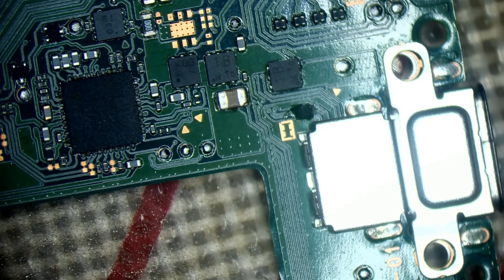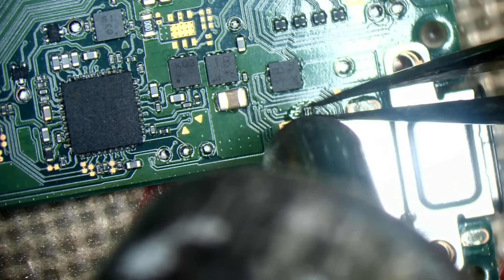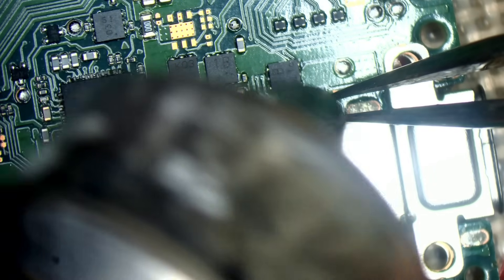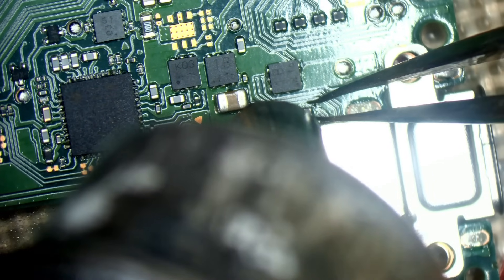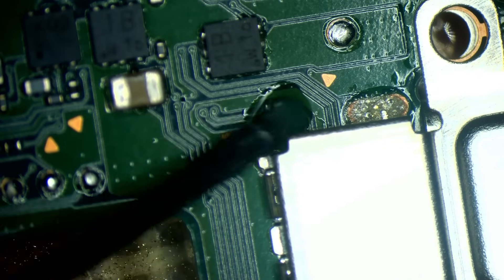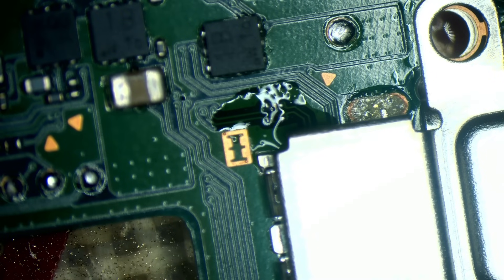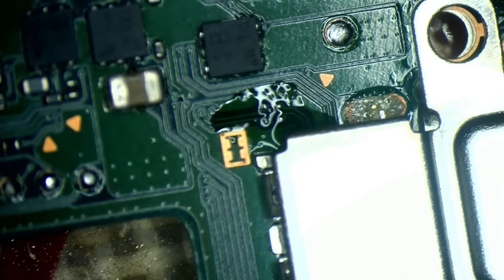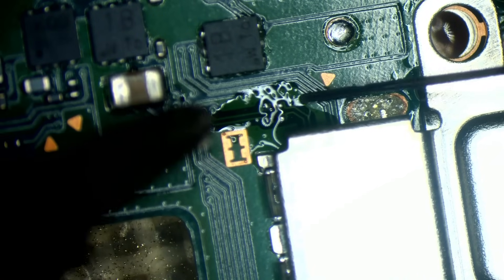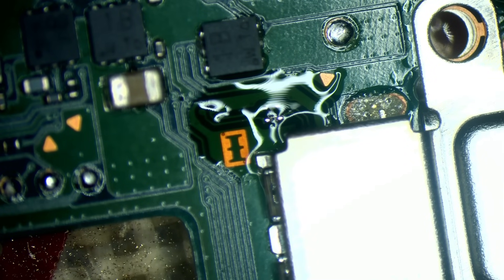Let's change that filter. It's unbelievable how such a small component can cause such an issue. That pinged off but it's fine — it's dead anyway. The question is: what blew that fuse — sorry, filter? The thing is they act like a fuse. They don't just act as a filter — if something goes wrong and too much current goes through, it can cause the filter to blow before it does any further damage to the console. So we need to find out what caused it — was it a bad charger or a bad dock?